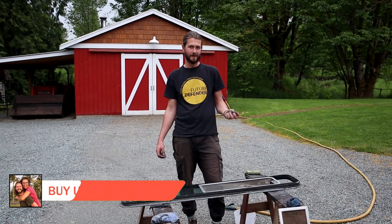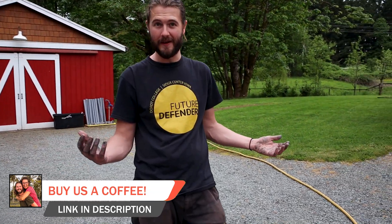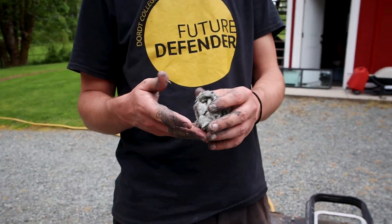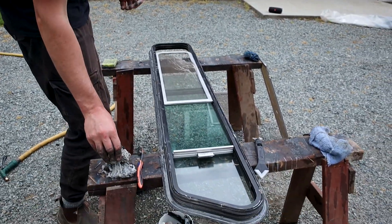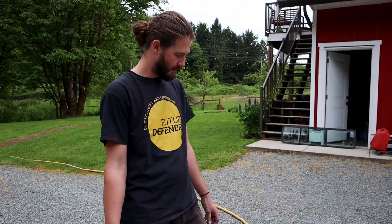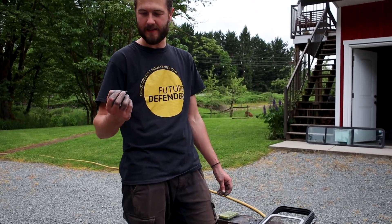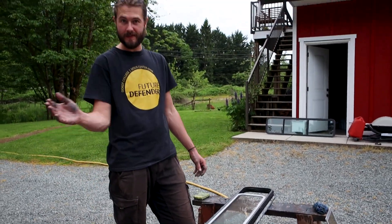This is the most frustrating thing I've had to do on the van. I've been working on three windows pretty much the entire day, because the people who did this last basically just put all this glue in there. It's terrible — I just have to pick it out of every crack with a nail, going through every little crack because it has to be really clean for the next step. That's why there were leaks — people just put stuff over top of the old material, so hopefully if we do it right we'll never have to do it again.